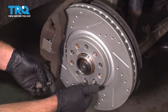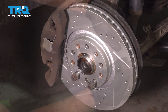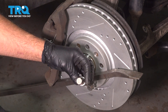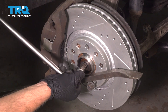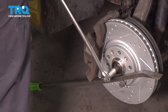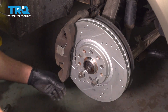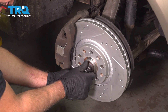I'm gonna loosen up the axle bolt. I'm just gonna lower the vehicle down and put a couple of the lug studs in. We're gonna use a long pry bar just to prevent this from turning. And take an H17 socket, or a hex 17-millimeter. Loosen this up. Take the two lug studs out and we'll take the bolt out.